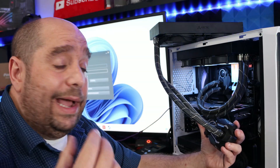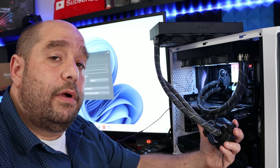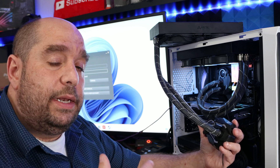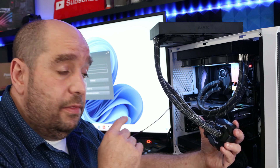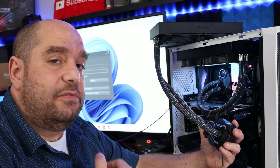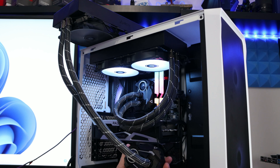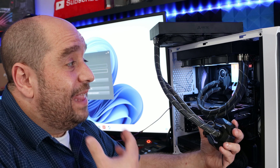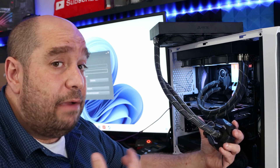Since this isn't something you do every day, I highly recommend testing on another system first: turn that system off, plug the fan header into a fan header on the motherboard, turn on the machine, go into the BIOS, configure that fan header to full speed, save and exit. Then go into Windows and test the liquid cooling unit to make sure A) you screwed everything in tightly and nothing leaks, and B) you don't hear any dripping indicating not enough liquid — that way you can disconnect it, add more liquid, and confirm you didn't make a mistake in the process.